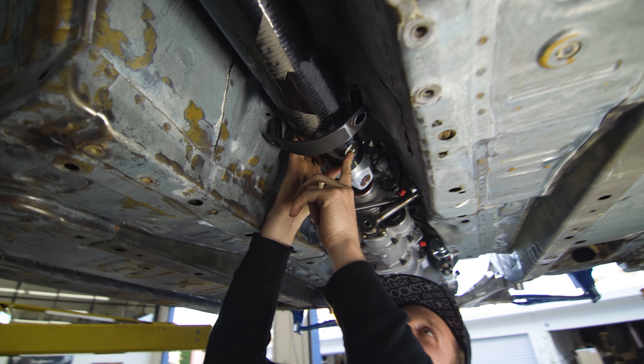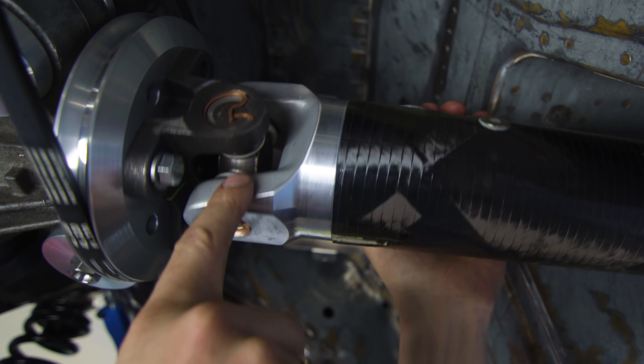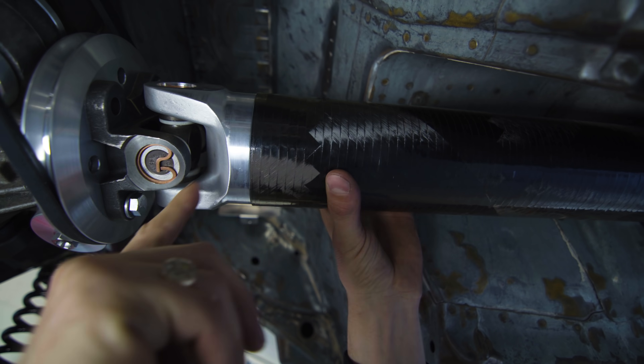You can see all the little weights that are glued to it. These carbon driveshafts — everything is glued. They still have metal ends coming off for the U-joints made out of aluminum, keeping everything extremely light and awesome.